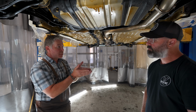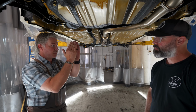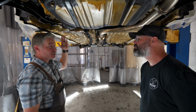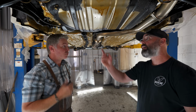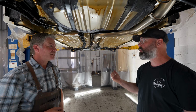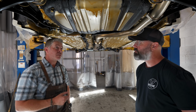Coat. Right. But you don't want it to keep doing that for the entire life of the product, because then it leaves the area that it's leaving from and winding down on your driveway too. Yeah, it's leaving other areas unexposed. So when this flashes off, this will tack up, and these will actually be relatively durable. It's a resilient wax. And where it's not as thick, you can feel it is tacking up already. So it tacks up pretty quickly, doesn't it? It does. Once it flashes off, it'd be ready to drive on the next day.